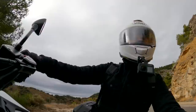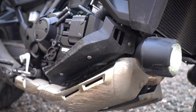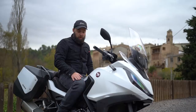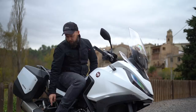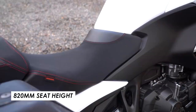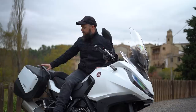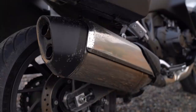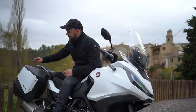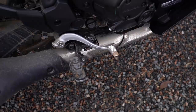You don't want a big bulbous front end, but if it can just push the air around your body you feel that bit warmer. The fairing is fairly substantial and there's a little rib that pushes the wind around your knees so you can tuck them in, and then lower deflectors keep some wind off your legs and your feet a bit drier. All morning we've had drizzle on and off, I had a rain jacket earlier but no waterproof trousers — just jeans — and I'm bone dry. This bike has the comfort seat accessory, nice and wide at the back, narrowing at the front, 820mm so very accessible, with 60mm of padding on the passenger seat, decent grab rails, and the side cases are shaped so they're not in the way of the passenger, with the exhaust slung nice and low.